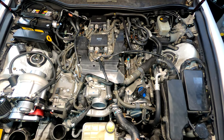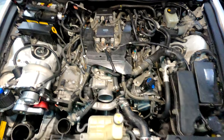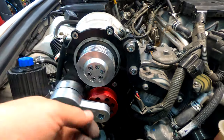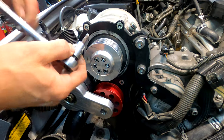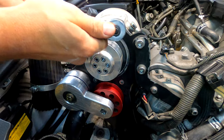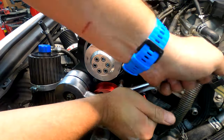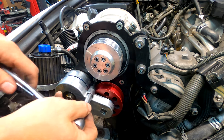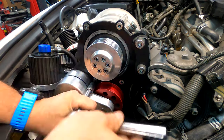Most of that piping we'll do from the bottom. Next we can remove the supercharger — four bolts, two here, two here. I went over this in the last video: remove the supercharger, drop it down, put the belt on, then lift everything up. The mount takes a five-millimeter hex socket. Be careful — these four bolts can easily strip if you're not careful. You'll probably need an extension on the lower left corner. It took me a while when I installed it — there are a few different phases: the bumper phase, the intercooler, the piping.